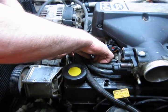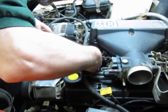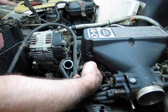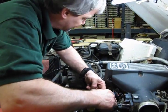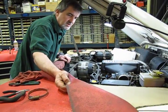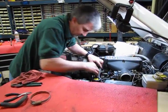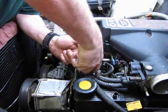Now, let's see if we get our fingers down in there. I'm going to need a little bit more on that clamp. Just something I'm going to note on the Defenders, because you have aluminum fenders and they're relatively flat on top. You'll notice, always have a fender cover, and I've even made cardboard cutouts to sit on top of the fenders, not just to protect the paint, but if you happen to put a force or too much weight, they can easily bend and leave an impression. Aluminum is very soft. So make yourself some cardboard cutouts, and in the end you'll greatly appreciate it.